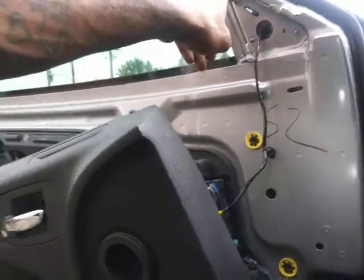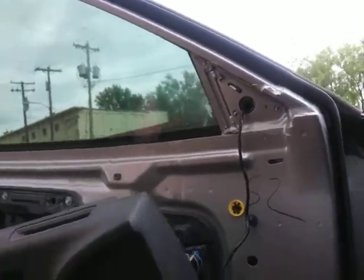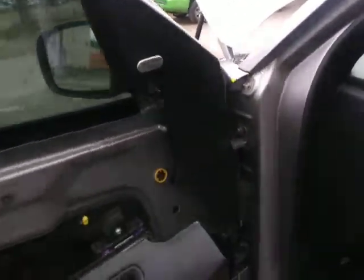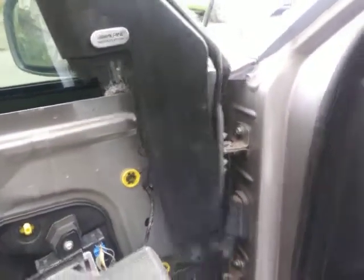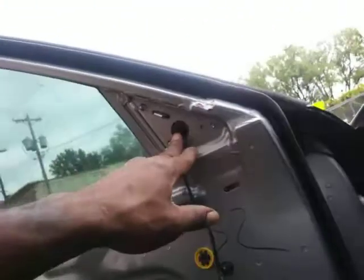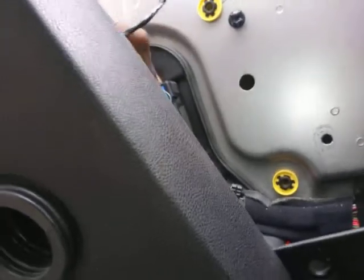So the mirror is 8 millimeter — it has three screws. This trim piece is going to be over it like that. Once you take that push pin rivet out, that trim piece will come from around the window and then it will expose the nuts that you got to take off of these studs for the mirror. Now that I got mine already off, which is 8 millimeters, I'm going to come over here and put the box for the controls and unplug the mirror.